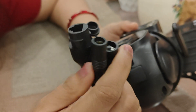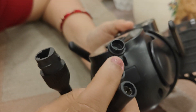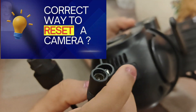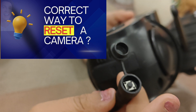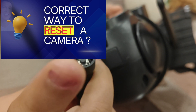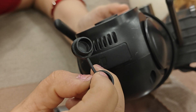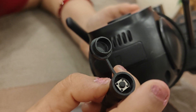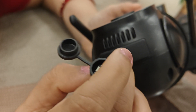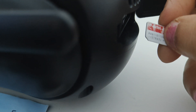You can also find the reset button on the wire. On the wire there are three kinds: the power wire, the LAN cable, and the reset button. To reset the camera, press the reset button continuously for six seconds until you hear a sound from the camera. After that, put the SIM in and follow all the installation steps once again. Please do not press the reset button multiple times as it could damage the camera.